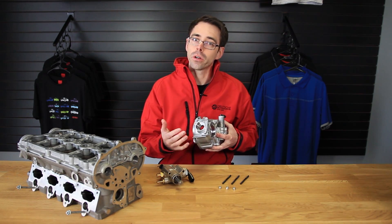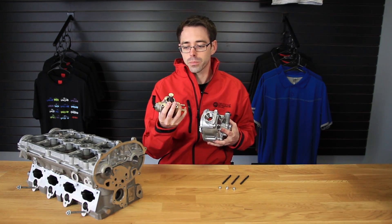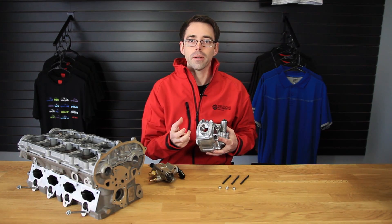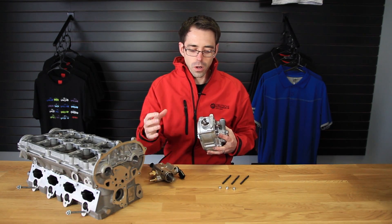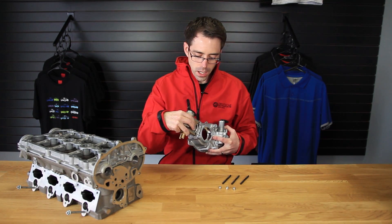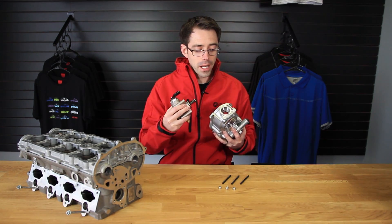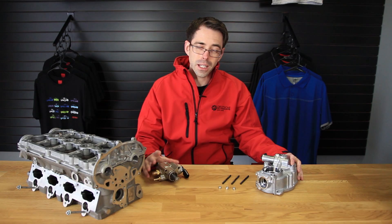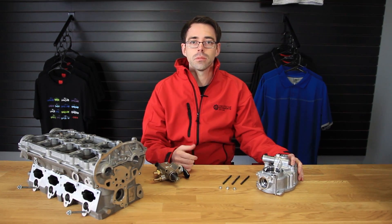The helicoil might be a viable repair and it could work, but the problem is the high pressure fuel pump — especially on an upgraded car that uses an upgraded high pressure performance pump — has even more pressure putting on this system, which means more tension on these bolts. And if you helicoil that and your helicoil rips out, which is possible depending on how weak the metal around the repair is, you're going to end up causing damage to your either brand new or replaced pump because as it's riding in there it will cock sideways. You could potentially damage a brand new fuel pump, possibly your camshaft, maybe completely destroy your housing and throw metal inside the engine. So we wouldn't recommend a helicoil because you could potentially cost yourself even more money after a repair like that.